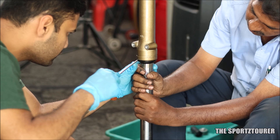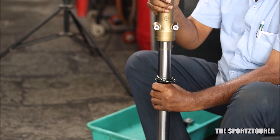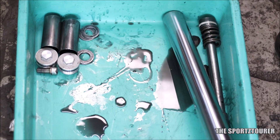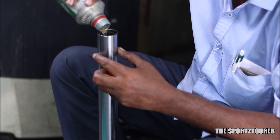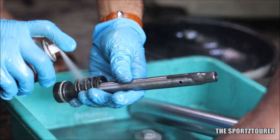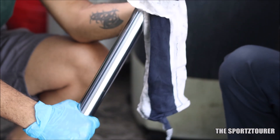After this, you can carefully remove the dust seal. Akash and his team did an amazing job in doing this process with utmost care. After the dust seal, the snap ring needs to be removed from its slot in the outer tube. Once done, the fork tubes can be pulled and separated, which takes the old seal out and also reveals the spindle and the fork piston assembly. All the parts from both forks were then laid out for inspection and cleaning. The fork tubes were degreased and cleaned with petrol — this is completely safe as the tubes are now free from any parts that might be affected by petrol. All remaining parts were thoroughly cleaned with parts cleaner, including everything from the spacers to the rebound spring and the fork piston assembly. The deep cleaning was followed by a complete wiping and drying of the parts so no contamination of aerosol and cleaner happens with the fork oil.